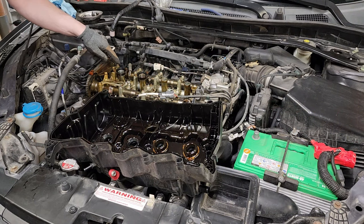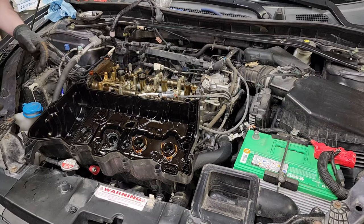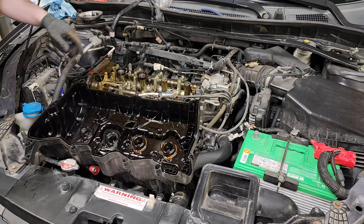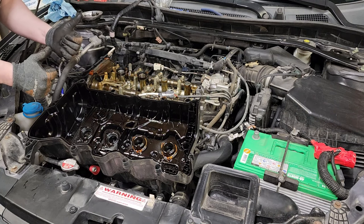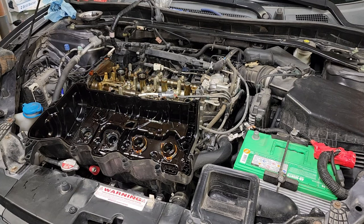Like I said, I was getting some oil seepage around cylinder one, and I guess that's probably because that seal wasn't okay. The gasket kit comes with four seals for your tubes that are associated with your coil packs, and obviously the molded gasket that goes around. Thumbs up to Honda for providing a molded gasket — this is actually really pretty, I'm very happy with that.